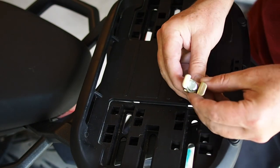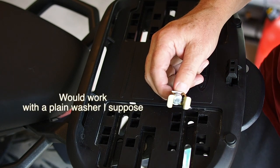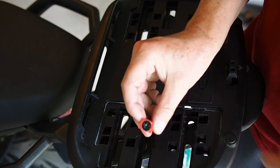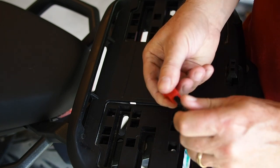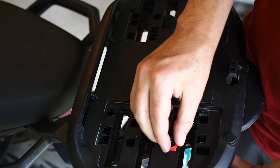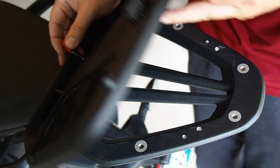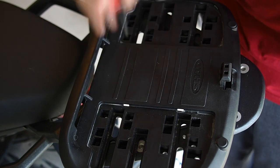When you get a quarter-20 bolt in there, there isn't actually room for a socket to fit around it, so that idea fell apart. There were other pieces in the kit we could use — these other guys here. There were also little plastic pieces that fit into any one of those holes, so that's what we chose to do. There's also a little piece that sticks out and could cause the plate to ride up, so that's another reason those specific holes were chosen.